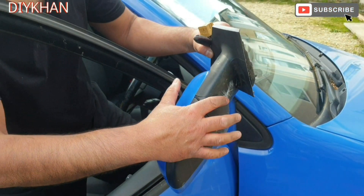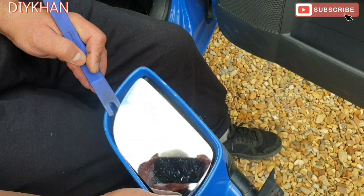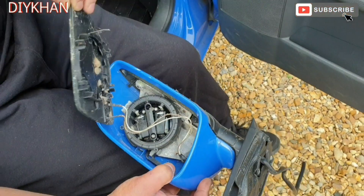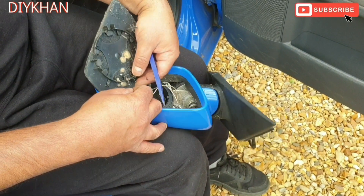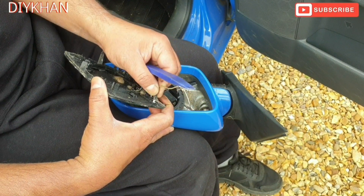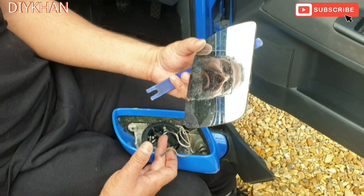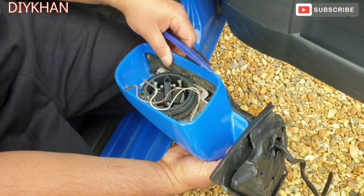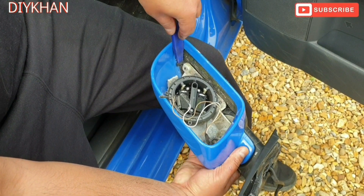You can see where it's been cracked just here by the stem. There we go — just taken off the mirror glass itself. There are two connectors here, two harnesses: the white one is the inner one and the brown one is the outer. So we have saved the original mirror.